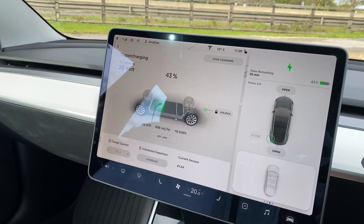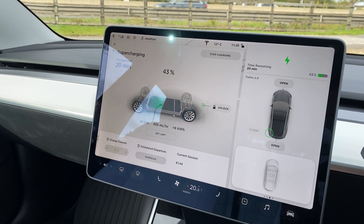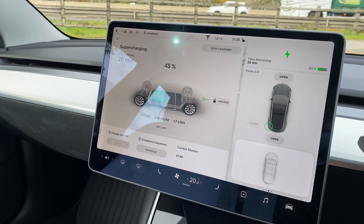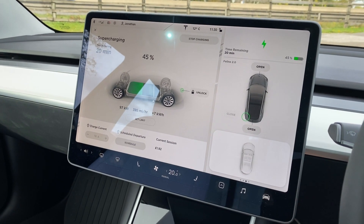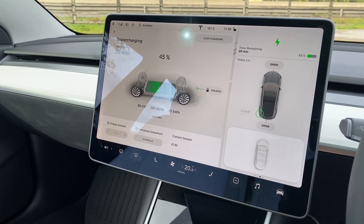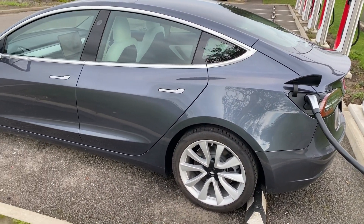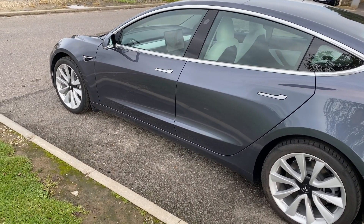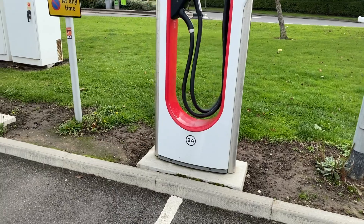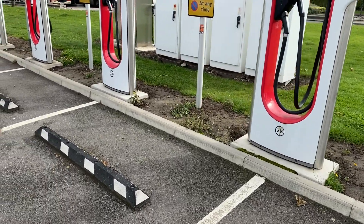At the start I'm getting around 100 kilowatts — that's 400 miles per hour of charging — and it's going to take about 20 minutes to get up to the 80% I've got set. The charge speed will vary based on a number of factors. First, the state of charge: the lower your percentage, the quicker the charge. As it gets up towards 80-90%, it really slows down — it takes nearly as long to go from 80% to 100% as it does from 10% to 80%. That's one of the reasons Tesla advise only going up to 80% unless you really need to. It's often quicker to charge to 80% and drive to the next charge point rather than wait to reach 100%. You'll also get a slower rate if the battery hasn't been pre-conditioned, or if it's a cold day in general, or if it's busy and you're sharing power with someone else.